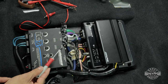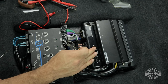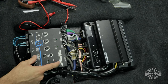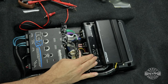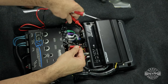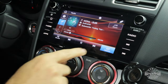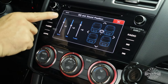This line-out converter has AccuBASS, which is bass restoration for rolled-off bass — I'm going to leave those in the default middle position. I'm going to set the gain for channel 3 first, which is going to be the amplifier driving my subwoofer. I'll play the 40 Hz, -5 dB tone on replay so it continuously sends that tone through the speaker leads into the line-out converter. I'm expecting the line-out converter to take those high voltages and reduce them to a more appropriate voltage. I'll plug in my homemade RCA cable to one of the ports.